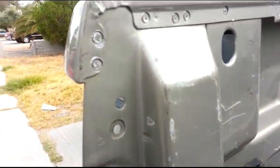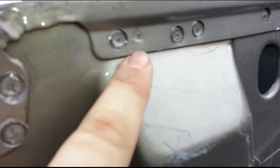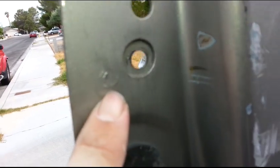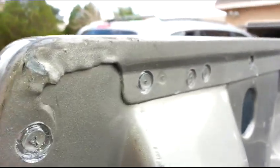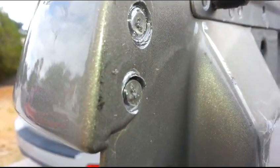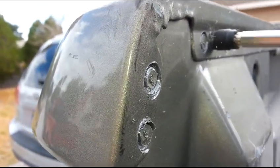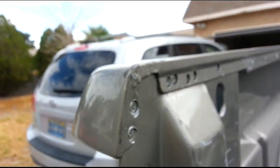Okay, so the bedside removal. You're going to drill out the spot welds using a spot weld cutter. You can see all the spots — that's what a spot weld looks like. Then you're going to use one of these bits, it's like six bucks from Harbor Freight. If you don't have a Harbor Freight, you can get one at Home Depot or something like that. Just push it in and see the bedside release.